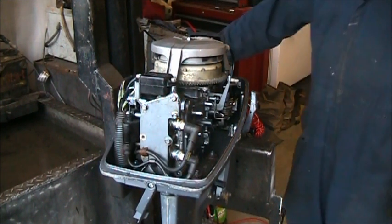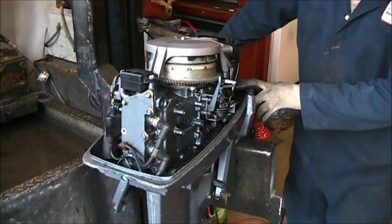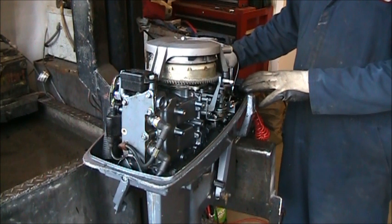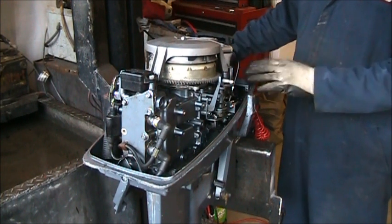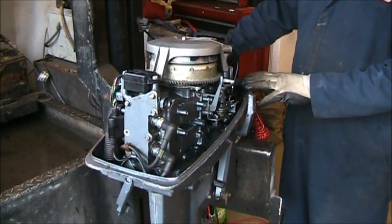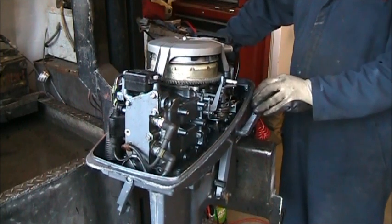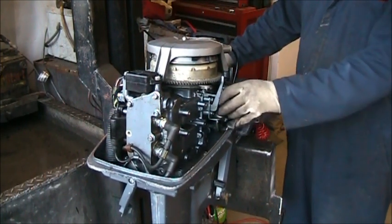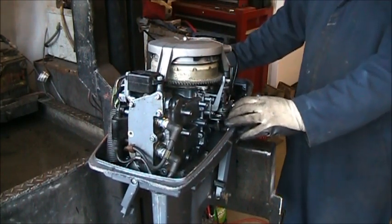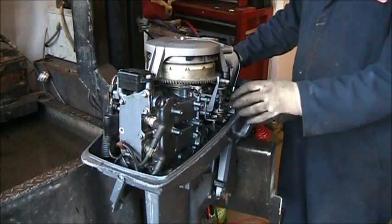Well, at this point, okay, he said that, see, it's got some movement on this. Oh yeah, it ain't moving out hardly at all though. So how can I adjust it? One of the complaints is he can't give it any throttle at all to help it idle. And that's because they're slopping that thing, it looks like. It ain't moving the butterfly here at all. What the heck's causing that? Yeah, the butterfly ain't even opening much.